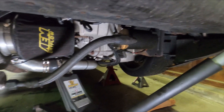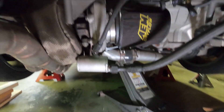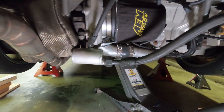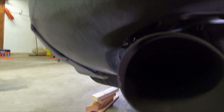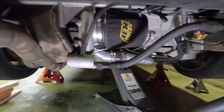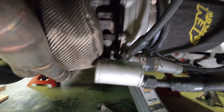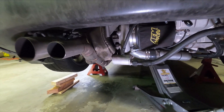They're easy enough to swap out — they're right there, which is another reason why rear mount systems are pretty cool. Just look at all that access. Then you'll notice it goes into this little catch can right here, and what this does is hold any residual rollback of oil. So when you shut the car off, the pressure's off and there's a little bit of oil left in — it rolls into there, collects, and does that before it backs up all the way into the turbo, which is not good for the seals. Previously I did have some oil coming out of the exhaust and it would burn a lot of white smoke for the first couple of pulls then clear up. So that really helped. It's also important to run a breather line — this one just vents to atmosphere. That's pretty much everything back here: the scavenge pump, one of these tanks or reservoirs, and that's it.